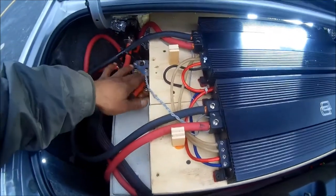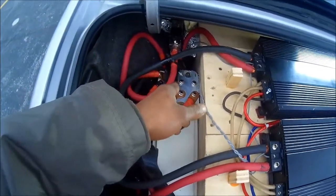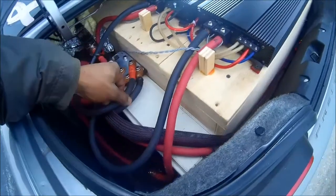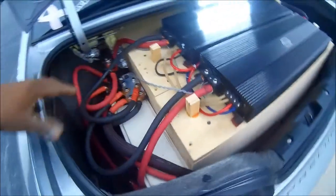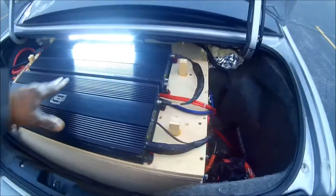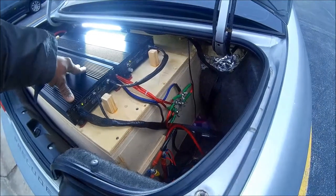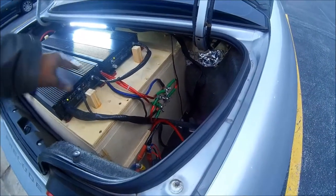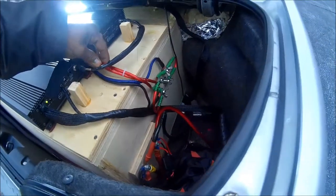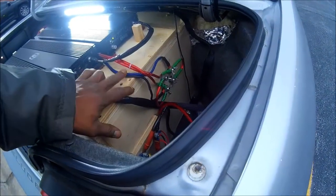Team Brown Note — that's the little Chicago team we got going. Right here I got an SMS-220 AGM North Star. Deal Customs six-way distribution block — it isn't made for the North Star but I made it fit, and it is definitely sturdy and safe. DD M2B — they are strapped and I am running them at .8 ohms final load, so each amp is at .4.